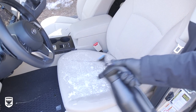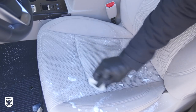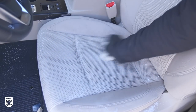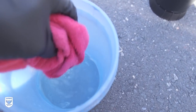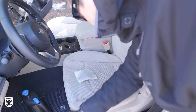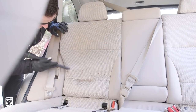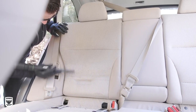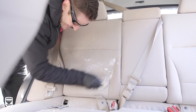Because I do this all day long, I put my shag fabric cleaner in the aerator to create foam in a wide pattern to avoid over-soaking the material — especially because it's my wife's car and she's going to use it immediately, so there isn't a lot of time to dry. You can use your favorite cleaner direct from the bottle or even warm water with a very mild laundry detergent from your house. The goal is to clean the material using the least amount of excess moisture possible. For the back seat, I had to vacuum up the extra dirt from my son's feet first before scrubbing to avoid pushing dirt into the fabric. It's easier to see what's a stain versus surface dirt, so vacuum first if it's really heavy.